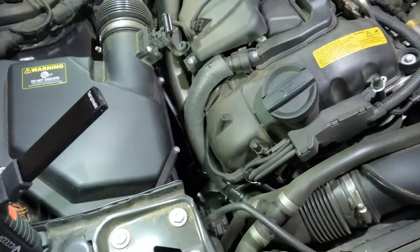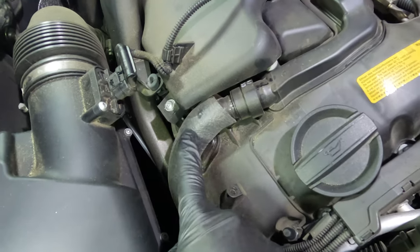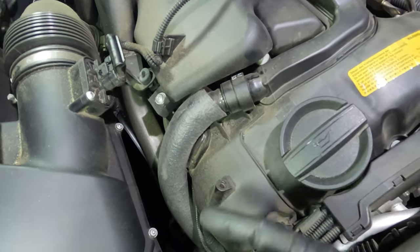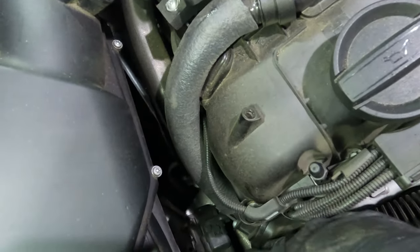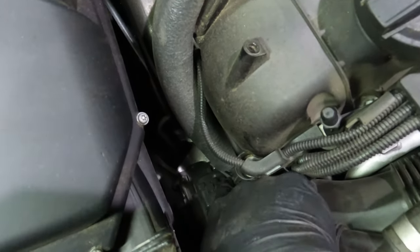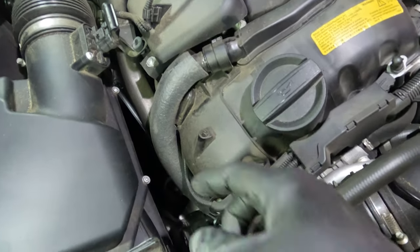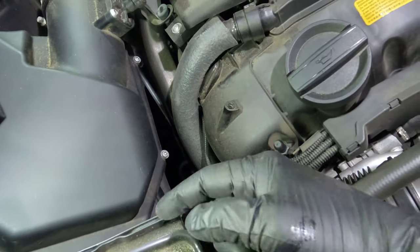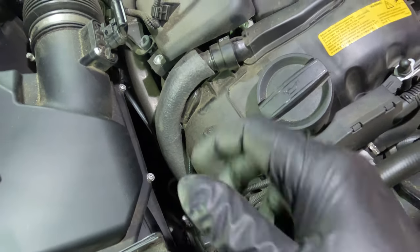Let's take a closer look at the work we're doing. We're going to be replacing the crankcase breather hose right here — this is where it comes up into the crankcase, recycling exhaust gases, and where oil condensates and other things come up through. At the bottom of the breather hose you have a T20 bolt. You're going to take that out and undo this clip at the top, then this hose comes off. The catch can will sit right in between — one hose coming up from below goes into the catch can, comes back around and goes back into the crankcase, catching all those particulates.